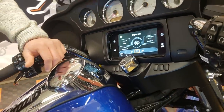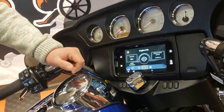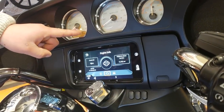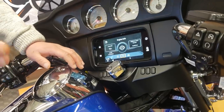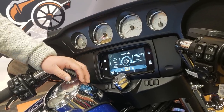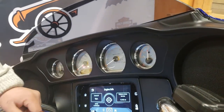It's completely automatic, so if it's cool enough outside it's not going to engage. However, if you are in stop and go traffic and you have this enabled, it'll automatically kill that rear cylinder and automatically come back on as you release the clutch and ride off into first. Now in order to engage or disengage that function, you're going to roll on the throttle forward and hold it there until you see it flash green — and as you can see, it's now enabled. That's more of a function for when it's 100 degrees outside and you're on a longer stop-and-go ride.